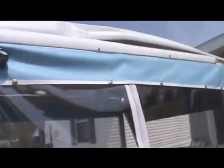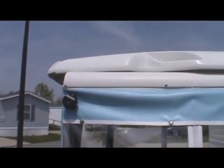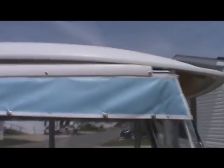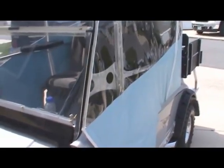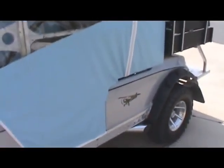Had to add some 4-inch PVC pipe up here at the top to close the gap. Worked pretty good — also deflects a little bit of water, because I wanted to widen the doors. When I built these I got a bow in the door, which gives you some more armrest room on the sides — about a 3-inch arch in that piece. I had a metal shop roll that piece of aluminum for me to put the bow in there. Works real well, really keeps the air off of you.